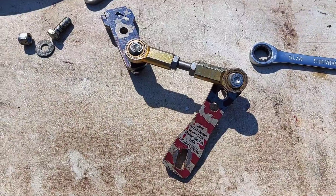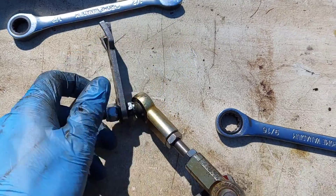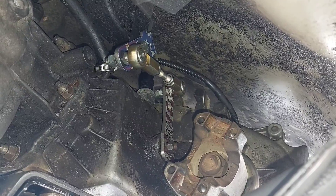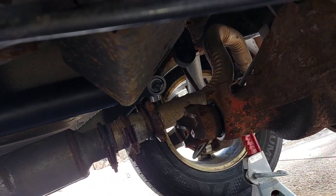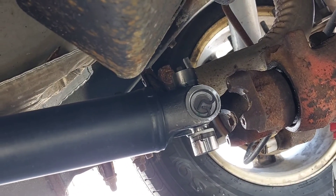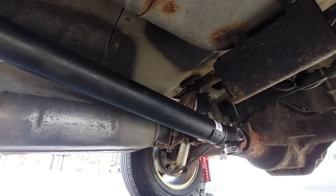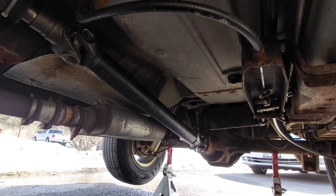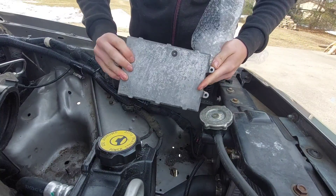I had to take the four-wheel drive linkage back out to readjust it entirely because I kind of screwed up earlier — for the manual install you need to use a different hole so it fits in there. Shove it all the way in so you can pop the U-joint into the pinion over there — you should be able to spin it. Jay came over and I taught him how to install a drive shaft and the starter. After tying up loose ends and plugging everything in, the ECU finally came. There it is — that beautiful machine.